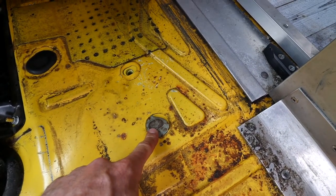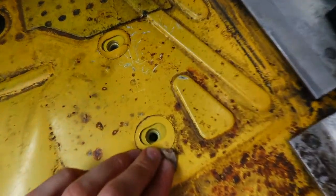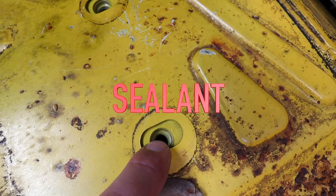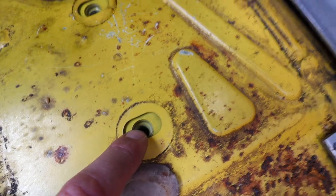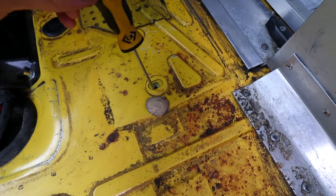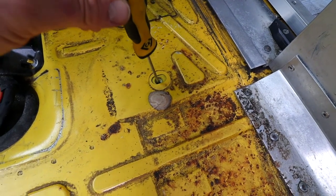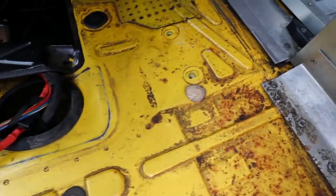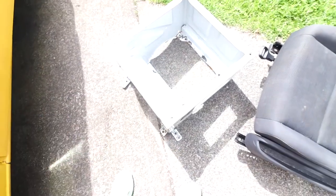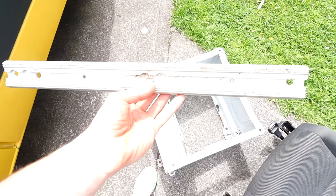When you take off the stickers, there's a lump of plastic in the hole — that's to stop air coming up through the van. You need to get a small screwdriver, stick it down through the hole and pop that piece of plastic out — it's just like a piece of glue. Once that's done you're good to go. I'm going to use the rails to secure the base in place, and then also use them now to secure the passenger seat.